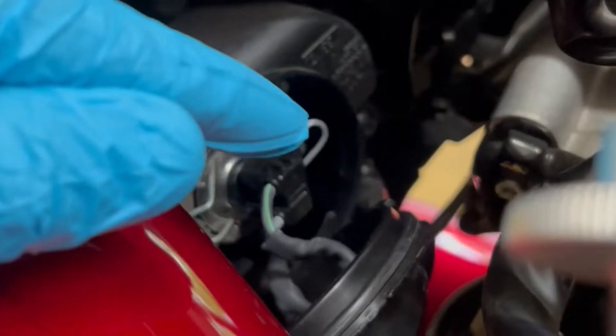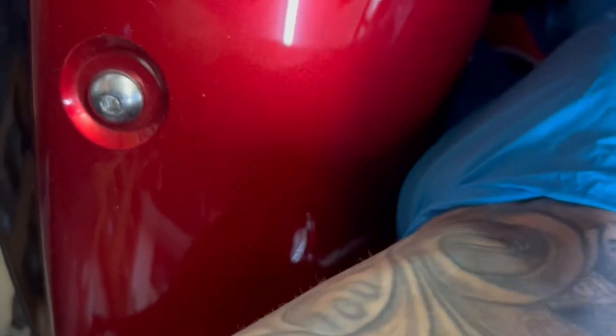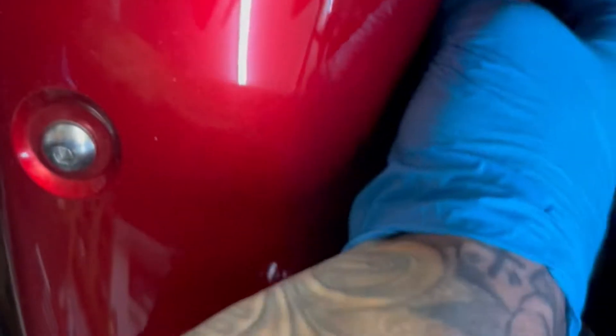So the bulb goes in a certain way in that socket. This clip — this part where my finger is — unfolds out this part right here, pull this way and then lifts, and then the plug just snaps in. Then you just put the cover back on. Cover goes on just like that — seals, signed, sealed, delivered. Knock the next one out real quick.